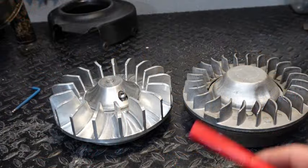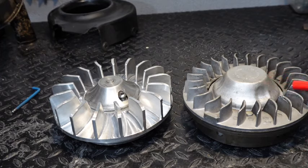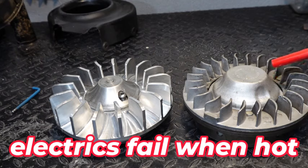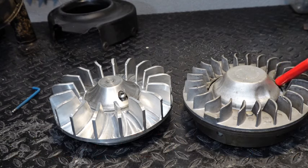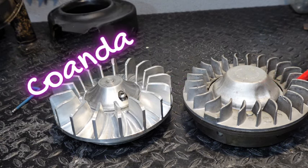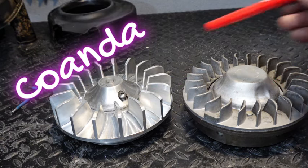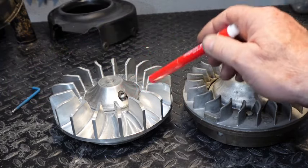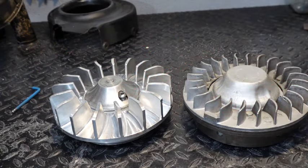I've got two flywheels here — this is the standard flywheel and this is an Indian electronic one. Even Mr. Innocenti knew about the Coanda effect and designed an inverted curve into his cover to divert air into the flywheel. That's why mine are machined with the same curve in them to increase flow into the flywheel — that is the Coanda effect.